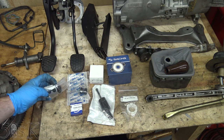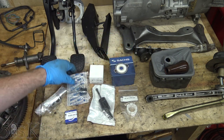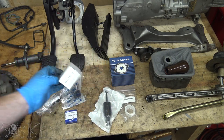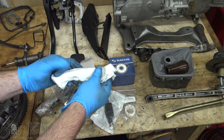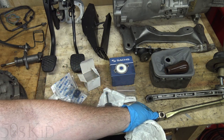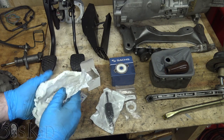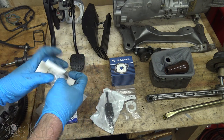For our consumables: this is the part on the back of the shift fork, a new pilot bearing, and a new throwout bearing. We've got the part of the shifter bushing — the white part that goes in there. Here's the clutch alignment tool. This is a part that most people wouldn't think to replace, but it goes on the end of the transmission where the shift fork hooks up. It has a little bushing on the inside that gets some play, and a plastic disc inside that kind of disintegrates over time. Replacing this is going to give you back a little bit more of your shifter feel.